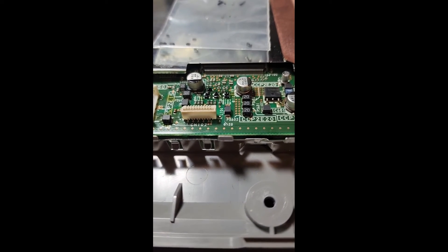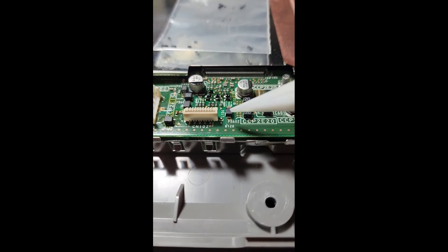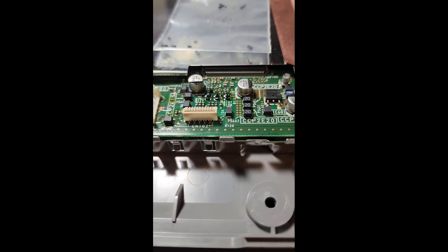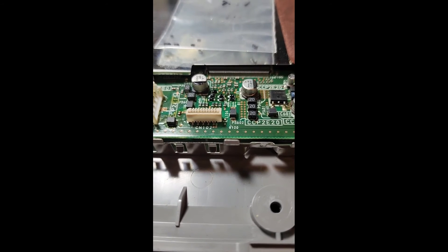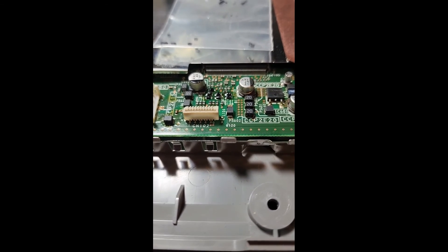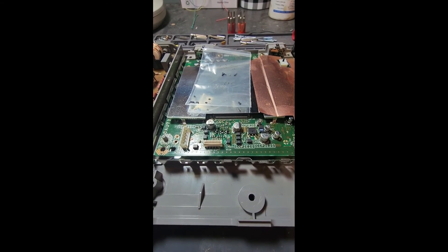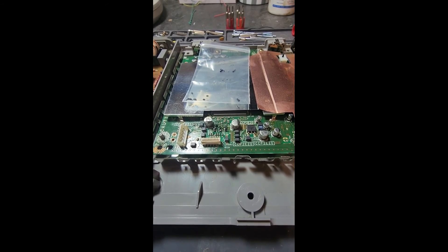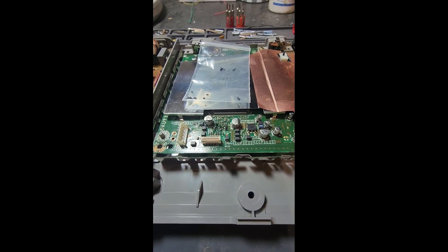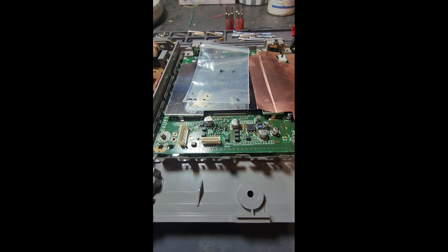Again, 3.9 volt 200 milliwatt SMD Zener diode — that's really all I have here. I've tested this console and it is working again. Definitely get some ceramic tip tweezers for soldering because these are so small — one little bump and they'll stick to your soldering iron. I wanted to put this information out there because it took me forever to find an active link and datasheet. I'll post links to everything in the description. Thanks for watching.